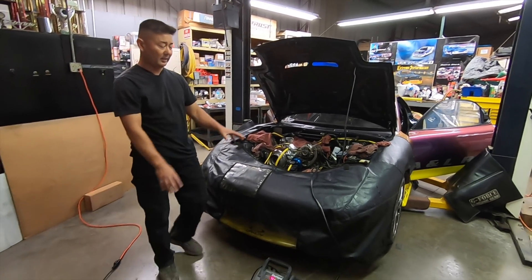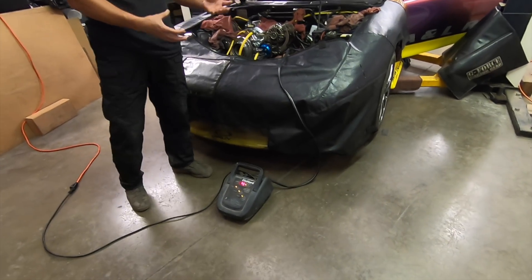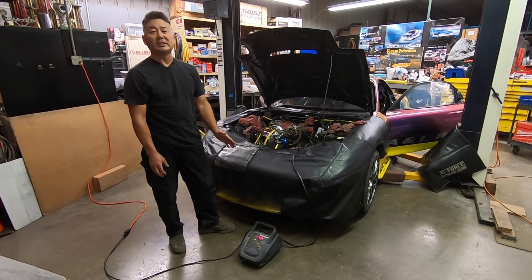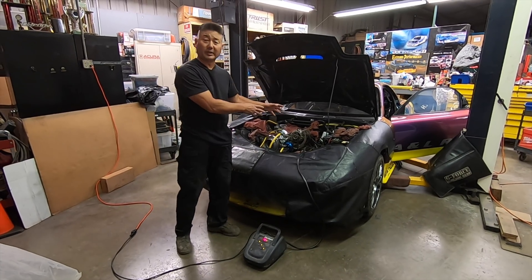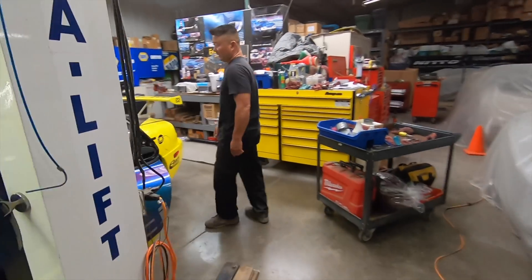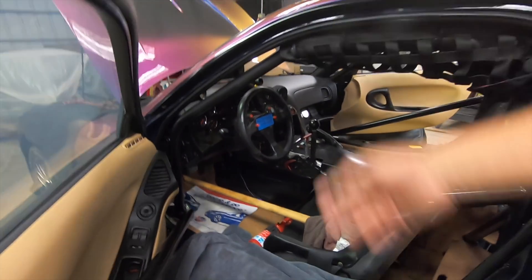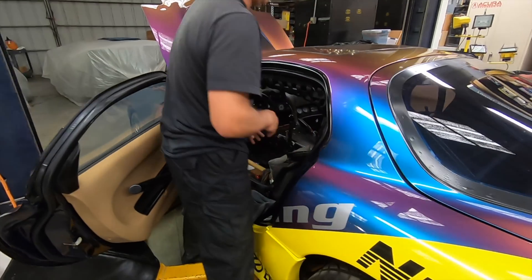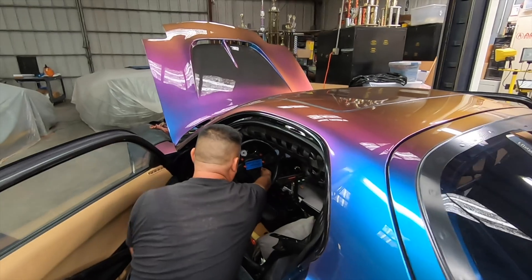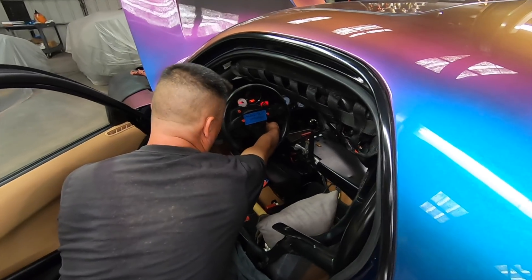Battery charger — it's really important to keep the voltage up, especially because you're going to be cranking to charge the system. We want it to be consistent. On top of that we're going to be doing a compression check, and the voltage needs to be consistent to get consistent readings. Inside I've set up a dowel to depress the clutch pedal, and I've got a little pillow — yes, I know it doesn't look super professional, but we're just going to do this real quick. Over here we have the oil pressure gauge. I'm going to hit the starter a few times since it's been sitting forever, just to make sure everything is free.